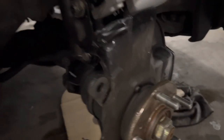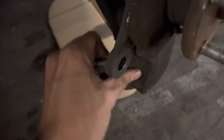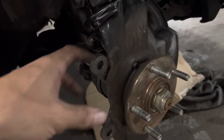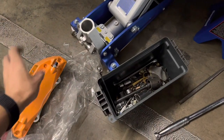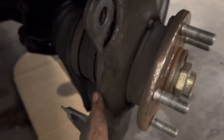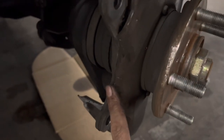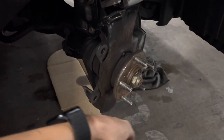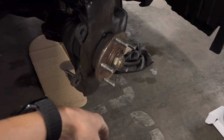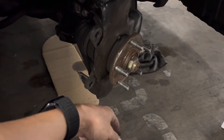In order to get this to work I had to bend the backing plate back. I'm probably gonna end up bending it until I break it, but I don't want to take everything off, so this is just gonna have to roll. When I tried to throw on the caliper it hit back there, so I basically smacked it in to give me some space. As long as this is flush with the spindle it should be good. I can see now why people just rip the whole thing off — it's scary when you test it and nothing seems to fit.